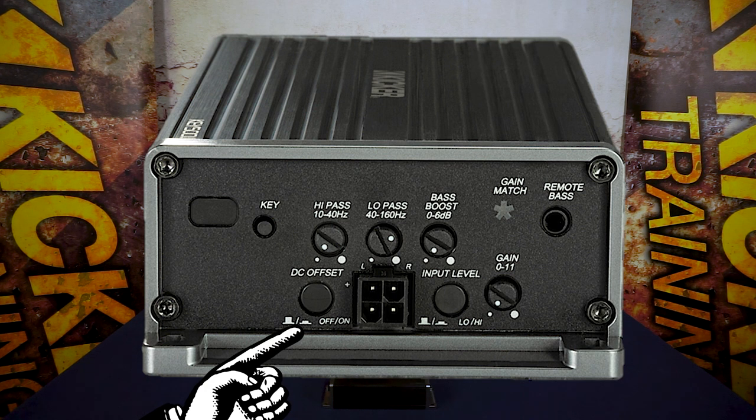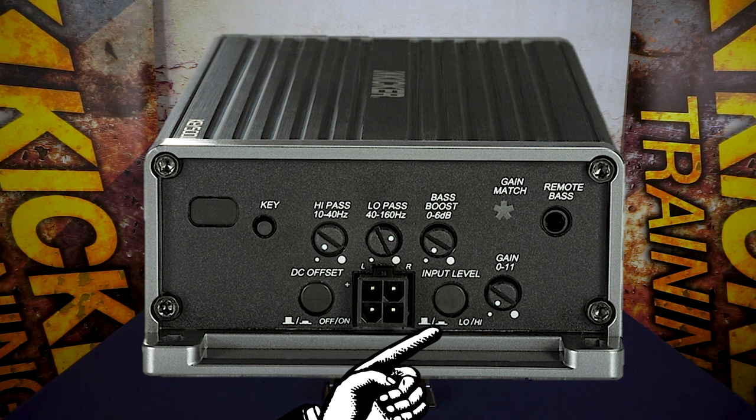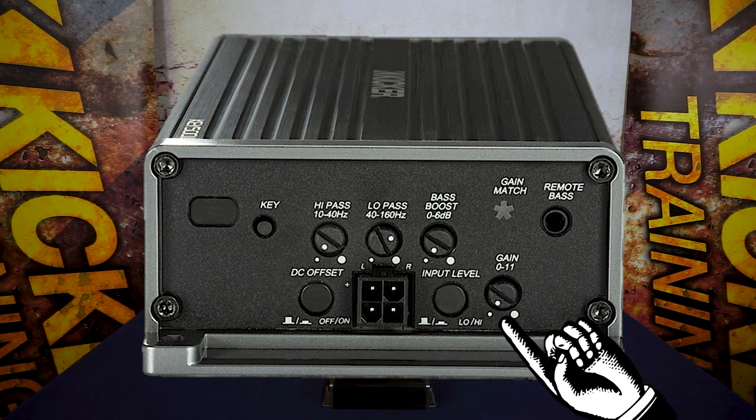On the bottom row we have an input switch. This tells the amplifier whether you want to turn on from the speaker lead input or need a switched 12-volt from the ignition key to turn the amplifier on or off. The signal input harness will accept 10 volts from an RCA input for an aftermarket head unit. If you prefer, you can cut the RCA ends off and run speaker wire right into the key amplifier — the key amplifier's input will handle up to 400 watts of power from any source, factory or aftermarket. The last switch denotes whether you're going to use the RCA input or speaker level input, and finally you have the gain matching dial.